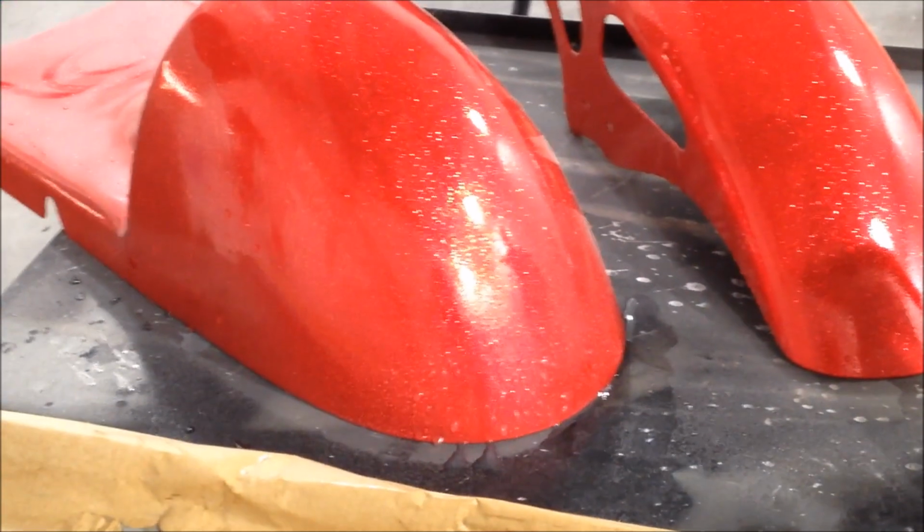Like I said, this is 1200. And you can start seeing the layers and layers of flake. Remember, this is what we're doing, we're refining that clear coat to give us the best possible outcome. And if you look at something we haven't done, you can see it's a little bit more crazy, obviously, because it's an off the gun finish. We've not done anything. So it's all bright and sparkling, looking lovely. This is very refined. Still sparkles, obviously, over there and whatnot. But when we get this to 1500, you can see the massive difference on how much more this is refined compared to that.